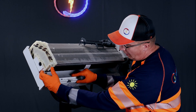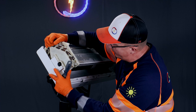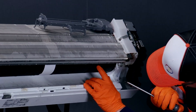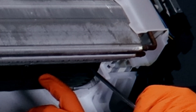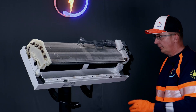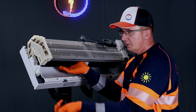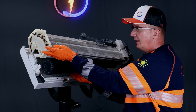Now I can lift the coil up a little bit because I need to take the fan motor blade out. To take the blade motor off, unscrew this one small Phillips-head screw on the right side. Don't take the hole off — just open it enough that the blade will slide left to right. Then lift the coil a little bit and take this bearing off. Lift it so you can slide the whole tube out.